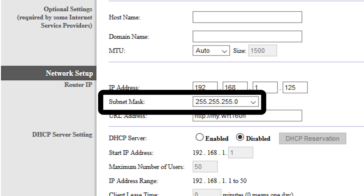On average, a consumer router will assign the last part of the IP as something between 100 and 150, so 125 is a good middle ground. If 125 is taken, which is highly unlikely, try 127, 128, 124, etc. If the second router requires a subnet or subnet mask, put 255.255.255.0.